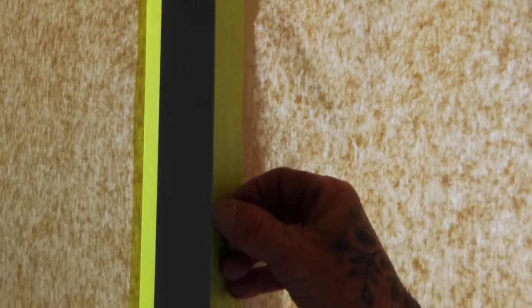Taped up the rubber the whole way around, up on the top, down. And then what we're doing as well, like I said, we're only doing the inside. So just tape up this edge. You don't want to roll it right around onto that next side. You want to make a nice straight line across this edge here. That way you're going to get a nice straight line without demasking any of the paintwork from the face as well.